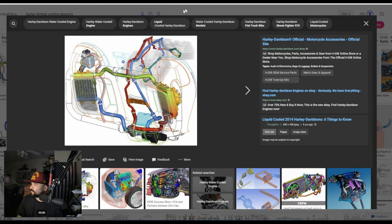Let's look at the old system. Harley didn't have to redesign or R&D a completely new system — they used what they already had. The same passages on the Limited's system. You can see the passages are focused around the exhaust valves, but instead of directing coolant into both jugs simultaneously, there's a split here that sends it to the rear and the front, then it works back up to a connector, down to your radiator, flows back out cool, and the pump shoots it back up to the heads.